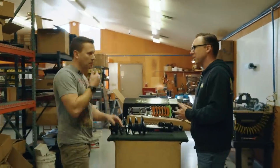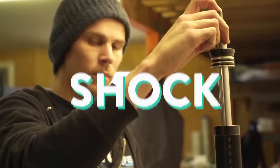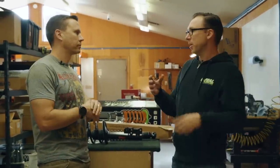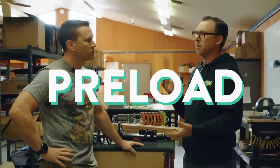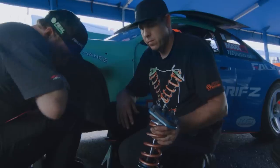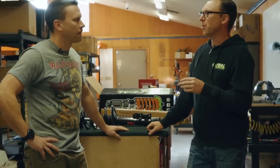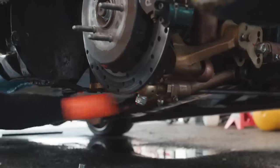A coilover is not just the shock — it's the spring and the shock together, so we have to choose the right spring and then build a shock to suit the car and to suit the spring rate we chose. Some shocks already have a spring around them, so it's technically a shock and spring all-in-one, but a coilover usually allows you to adjust the preload of the spring, which changes the ride height and the droop. It's a tuning factor you get from a coilover. We can make it all accessible as one unit, which is very helpful on a race car where you're constantly changing things out — maybe even the spring altogether. It's one unit: you pull it out, change the components, put it back in.